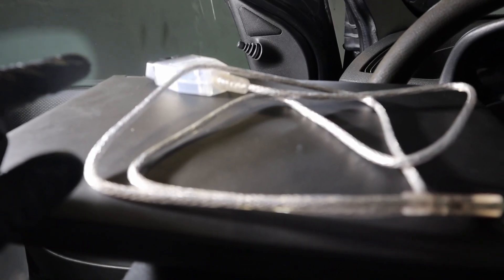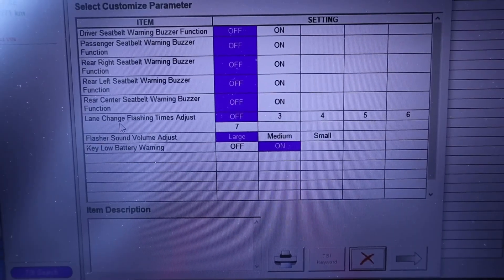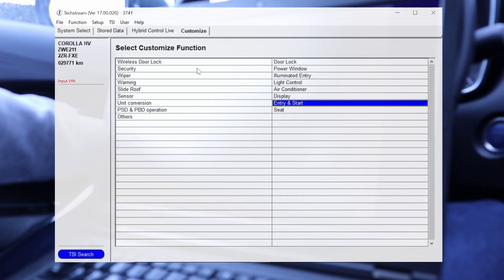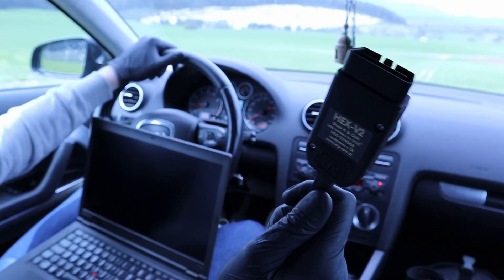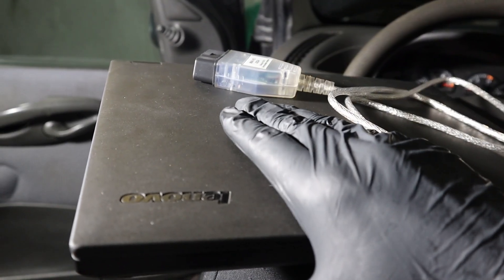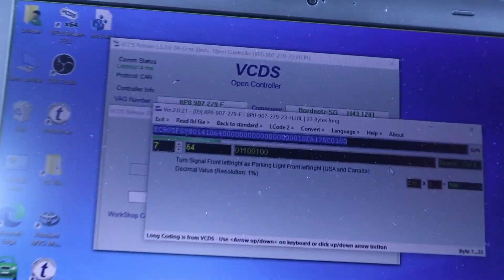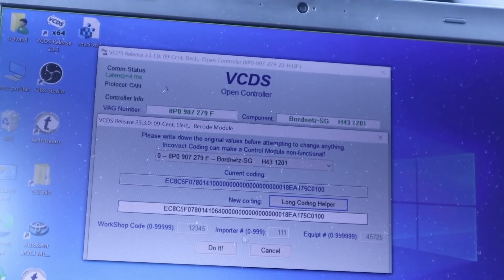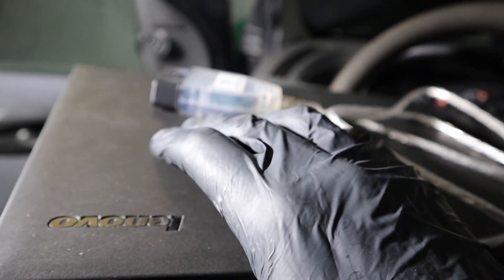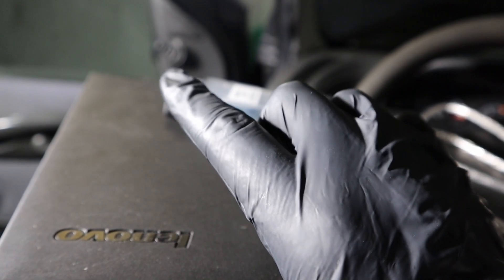However, a laptop can be a great choice for specialized software for one brand. For example, a Toyota TechStream cable costs around 40 dollars and comes with a clone of Toyota's OEM diagnostic software, giving you advanced functions for that brand. I also use a laptop for VCDS, which is probably the best aftermarket diagnostic software for Volkswagen and Audi. With specialized software you can get features like bidirectional testing, coding, unlocking new features, and complex live data checks, often at a cheap price. But if you want one OBD2 scanner for multiple brands, I would choose a code reader, a Bluetooth adapter, or a professional scan tool.